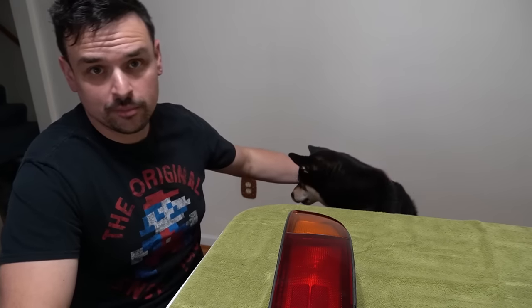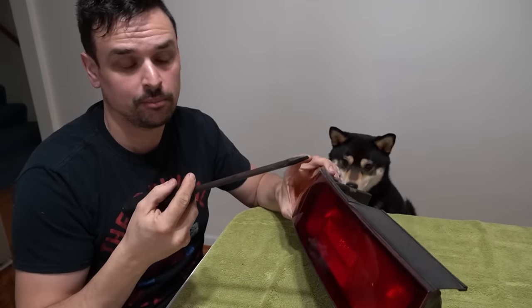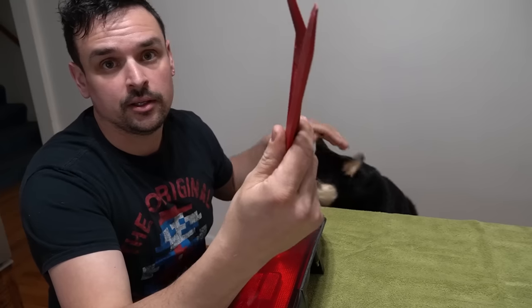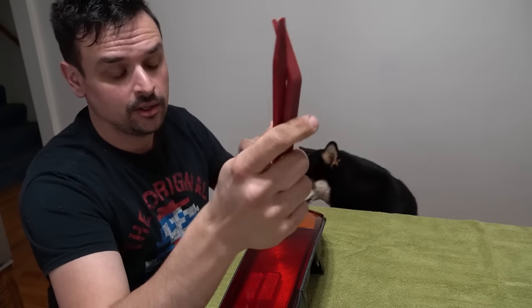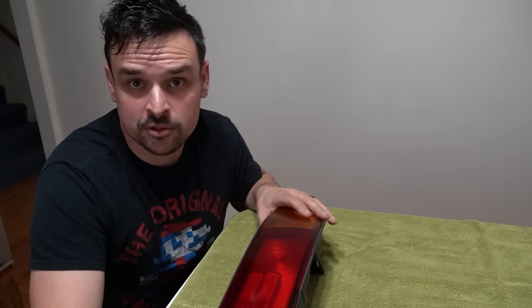And this next step is very important, so that's why I have my supervisor with me. So you're not gonna wanna, no, not that one. You're not gonna grab the biggest, baddest screwdriver you have to do this, because the metal can mar the plastics or even crack the lens. So I highly recommend getting plastic pry tools here. You can get them at Harbor Freight, Amazon, they're pretty inexpensive. And this will help prevent accidental breaking of the plastic or the lenses. Well, supervisor's no longer on duty.